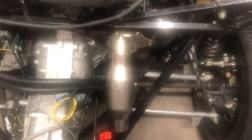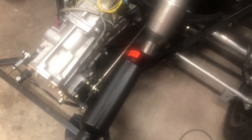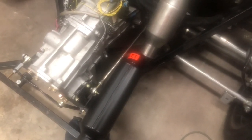So I'm not going to weld anything today because I don't want to get the welding machine out. I'm off tomorrow, so I'll do that tomorrow. What I want to do today is get everything marked and cut, so tomorrow all I have to do is weld it, and then think about powder coating it. I should be able to powder coat it with no issues. I did a little research, and I don't think there's an issue with powder coating a catalytic converter or a muffler. They both see temperatures higher than 400 degrees as part of their daily use.